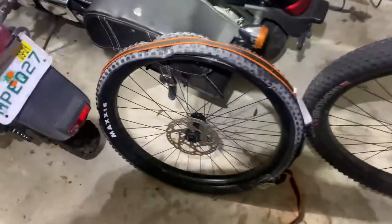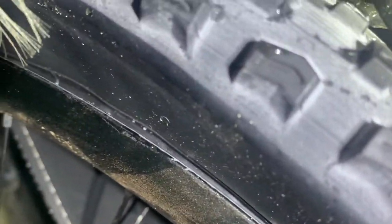I'm going to show you how to get a very stubborn tire to seat. The trick is a ratchet strap all the way around in the middle. You can see even with that, especially where the ratchet part is, the tire still is nowhere near seated. But that's okay. What you want to do is get it seated as much as you can all the way around it.